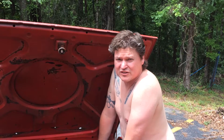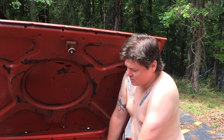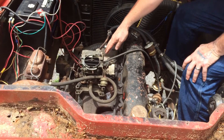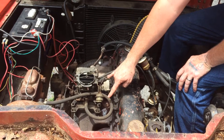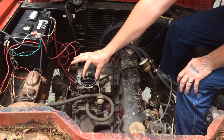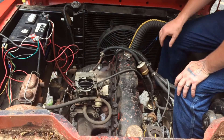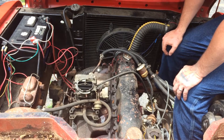The final gearing for both axles — it's Dana 44s front and rear with 4.56 gears. Also if you notice, we have a Clifford four-barrel intake, which is really nice, but they've got it adapted down from a four-barrel to a two-barrel to a one-barrel, so that's not the ideal setup. It also has six-into-two headers as well — I'm assuming Clifford.